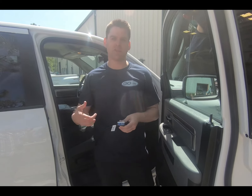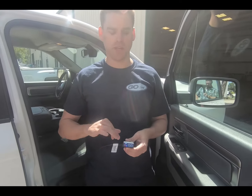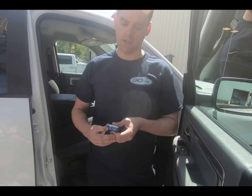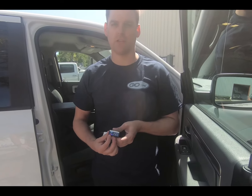We've pulled the vehicle outside. We restarted the truck and let the GPS go through a boot cycle — it took about two minutes for all our lights to come on. As you can see, we have a red light, which is our power light, our blue light which is the satellite, and we're missing the green light which is the cellular, meaning it's not going to be communicating.